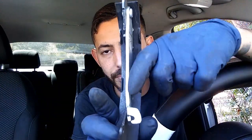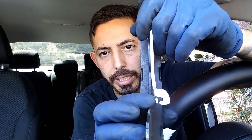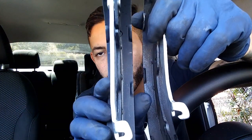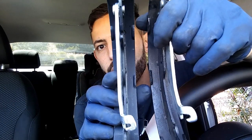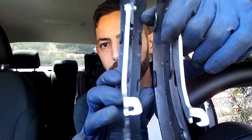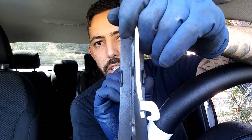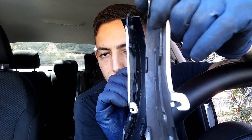What I mean is that this piece here — this is for the emergency brake shoe — needs to sit right in the middle. Just like how this one is. These are both for the same side; there's going to be one for the driver's side and one for the passenger's side. See how that bottom piece where the silver is lines up. You need to make sure they match, otherwise you're going to have a hard time setting the drum disc on the brake shoes.